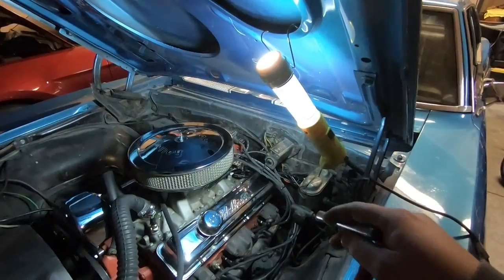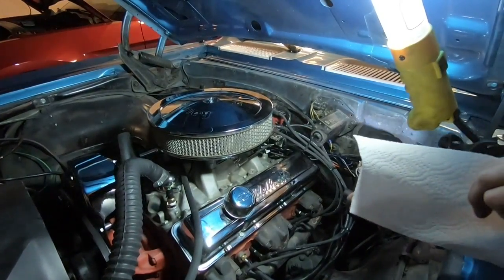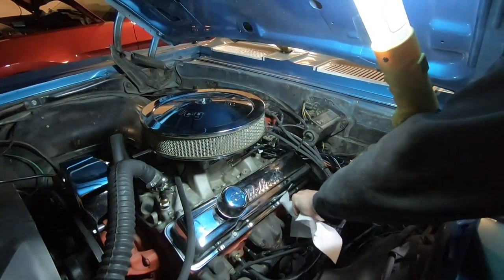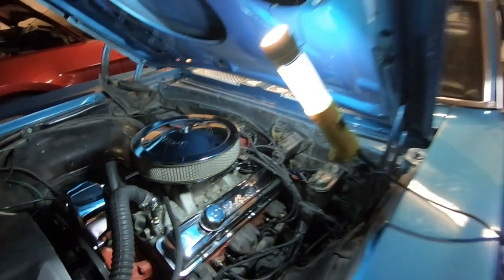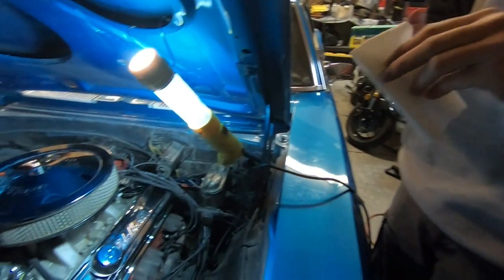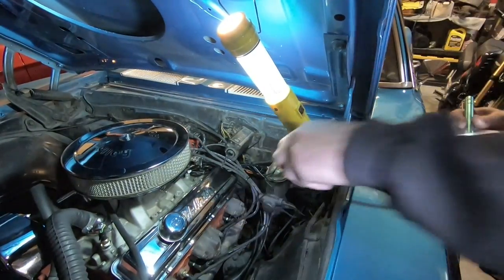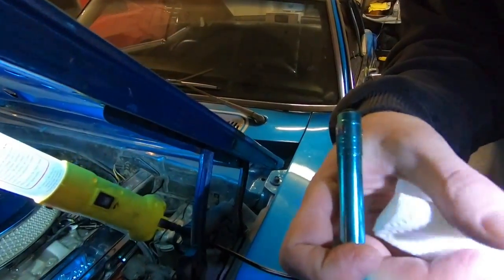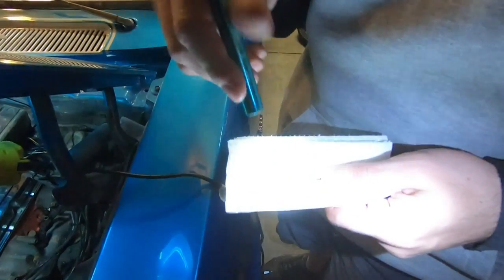Do you want to check oil? All right, guys, so let's put this back in. We're going to check the oil here. We just pulled it out. You want to pull it out and wipe it, put it in there. I let it sit while I fold my paper towel up. Three folds. Four folds. It's just ridiculous. There we go. So I take this out, I grab it where it's probably not going to have oil, I set it on here and I pinch it over, and mat it down, and I take a peek.